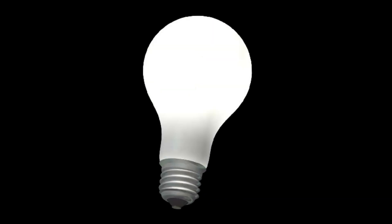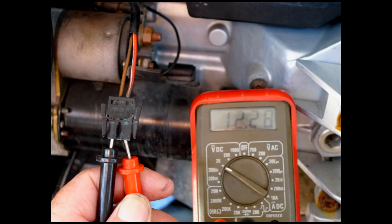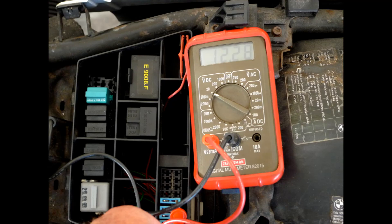So the big question is, how do we check the battery on the motorcycle? The battery is hidden underneath the gas tank, which presents a problem — we really don't want to remove the gas tank. Thanks to some message boards, I was able to find a solution. We had to find some other positive terminals on the motorcycle, such as the positive on the starter, the accessory plug positive and negative by the starter, or we could wire it into the fuse box.